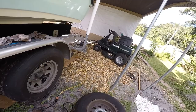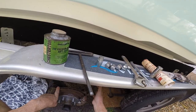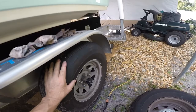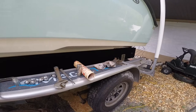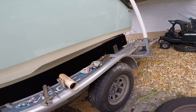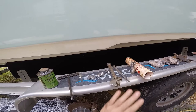I'm going to put some grease on the inside of the rim and then get the wheel back on. There's no bleeding involved because we didn't take any brake lines apart — we just put the pads on and it'll be good to go. I only bought enough pads for one axle, so I'll buy another set for the other side. When the pad material comes completely off the metal backing plate, that plate will start dragging on the rotor and you'll tear the rotors up — so don't let it go that far.